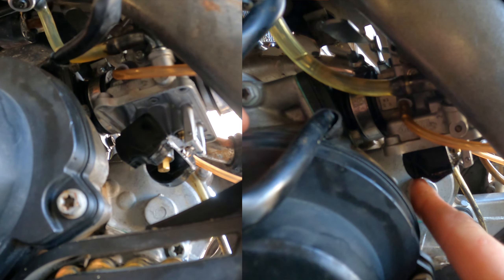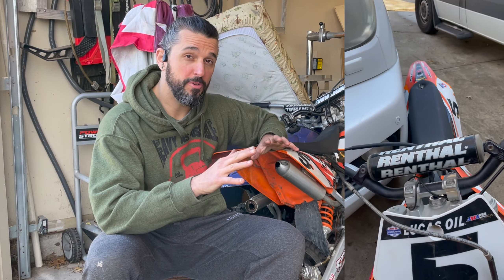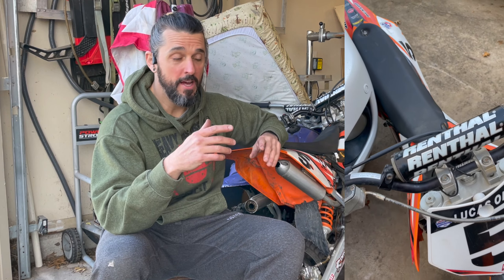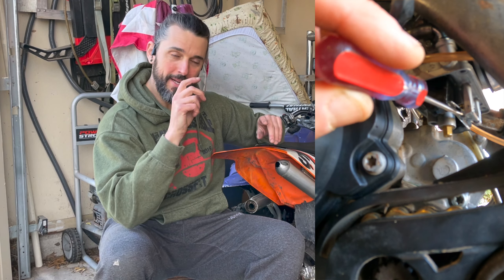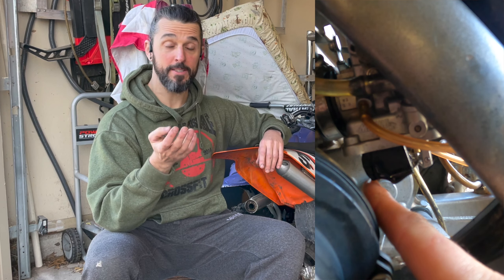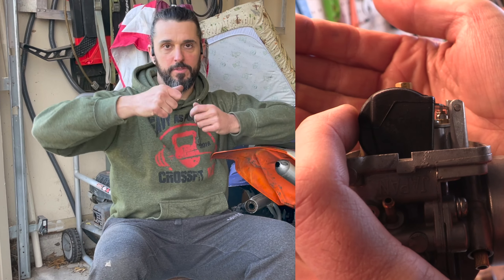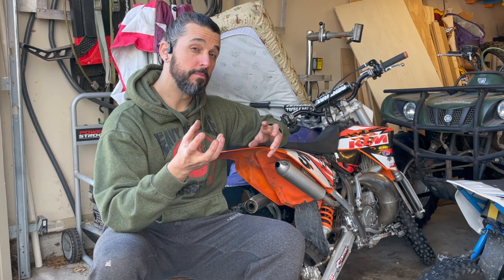This helped me learn so much more about how the float and float valve work in the carburetor. Here I am adjusting the tang on the float on the bike — two different angles of raising the float and it shutting off the gas coming out of the tank. With Liam's 2014 KTM 65, it looks like we have the carburetor figured out. I now understand more about the mechanics of the float, the float valve, the tang, and the bowl of the carburetor.